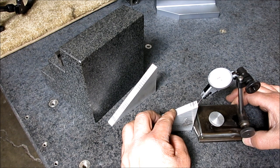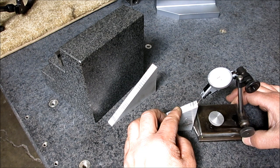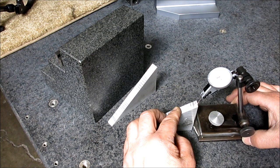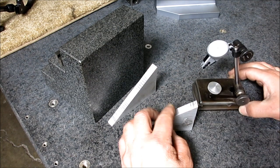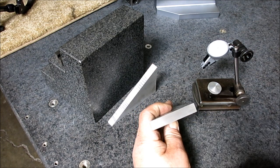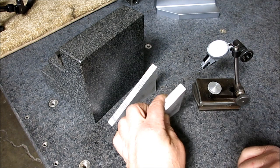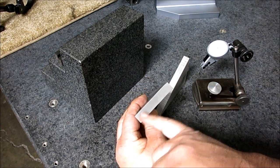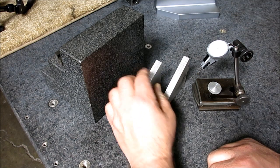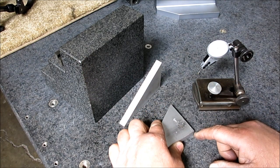That one's a lot better. Make sure I'm bearing properly here. One and a half, two tenths. So that's two tenths on that one. You can even see the little mark from the indicator ball. Just beware of that kind of thing. This one's pretty close here, so we're not going to monkey with that one.